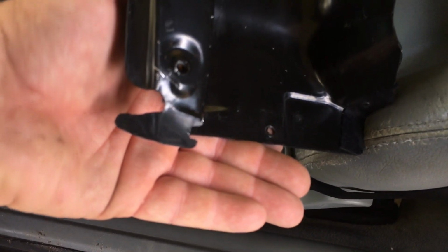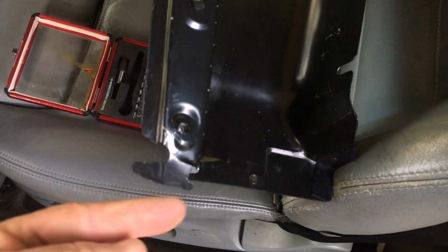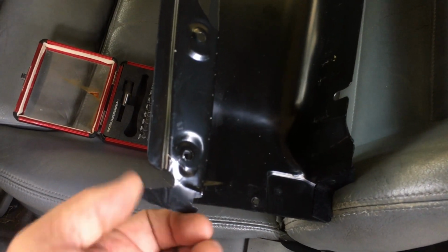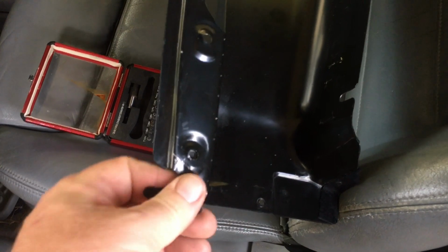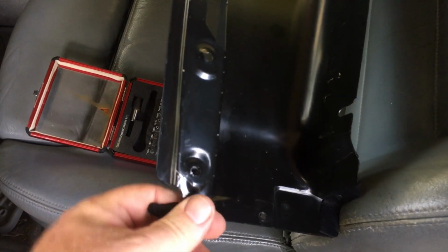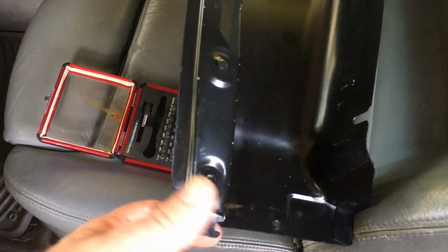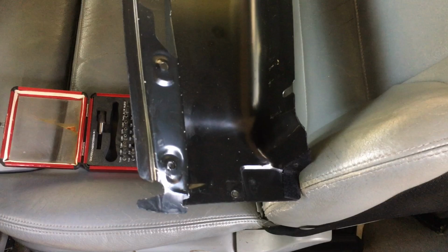The corner is wrapped around those 2 sharp areas, and it's just a stamped piece of sheet metal. It's not really deburred or anything, and it can cut that rubber quite easily if you don't do it right when you're taking it off. So my advice is not even to take the seal off to begin with. Just drop the panel off and let those window seals hang right there, and lay that someplace where nothing can bump it or rip them off, because it's quite a bit of weight dangling off that corner, and it's just asking to get cut.